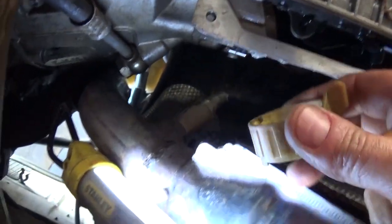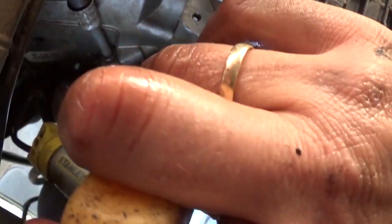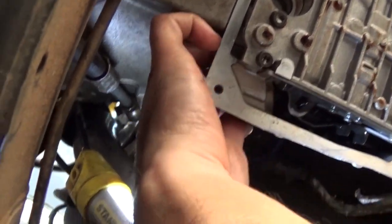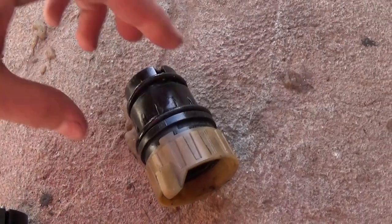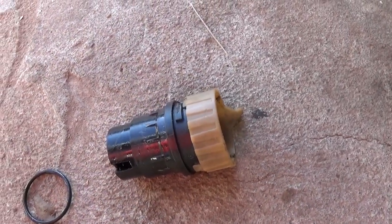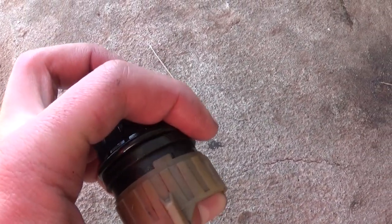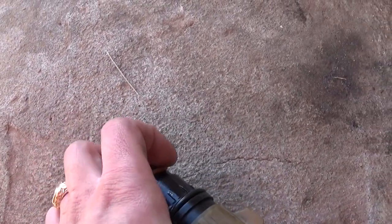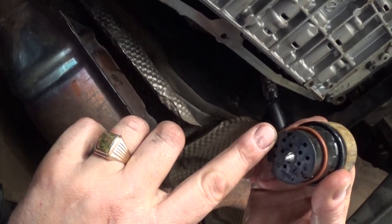Pull the plastic ring out — we'll install it later. With a small screwdriver, pry it a little bit to get the seal out, but be careful not to break it. Got it out. So that's the old seal. You can remove both of them the same way — just pull them out. Then get the new ones. They'll be a little bit tighter than the old ones, which is expected since the old ones were leaking. This one is actually orange — they were a little bit loose.